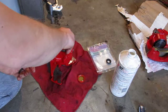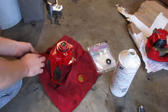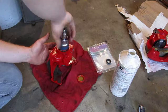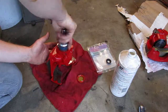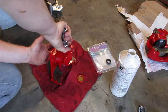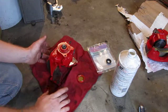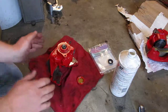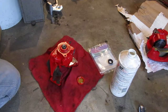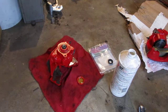Go counter-clockwise until it drops in. Be sure to check the shop manual — I don't know right off the top of my head what the torque specs are for this end cap piece, but I think it's fairly high, in the neighborhood of 90 to 100 foot-pounds. Just be sure to consult your manual.